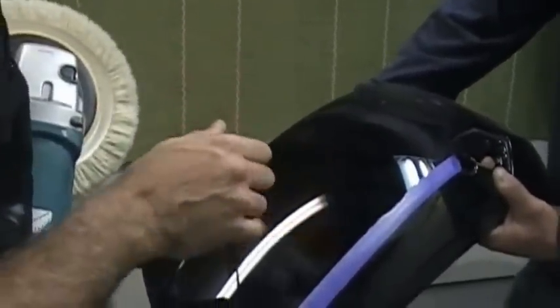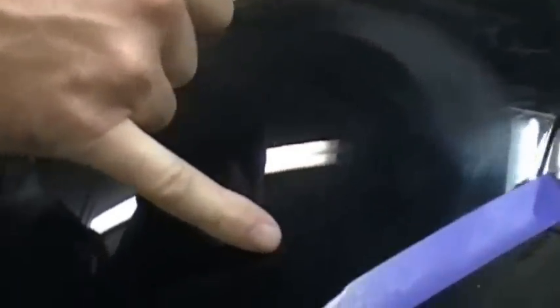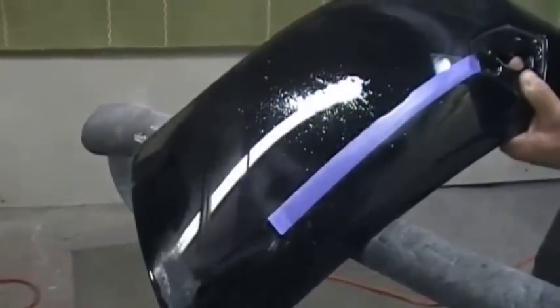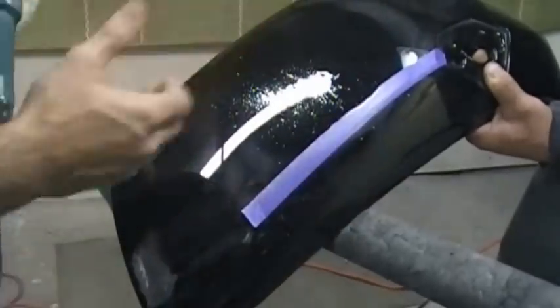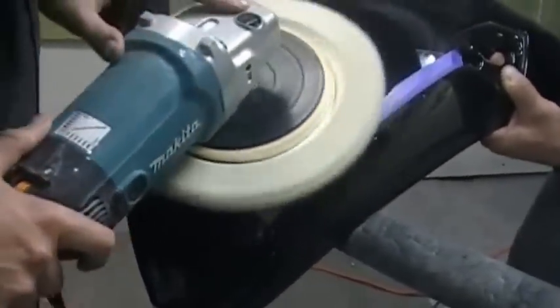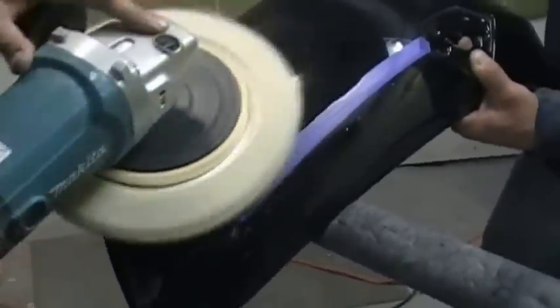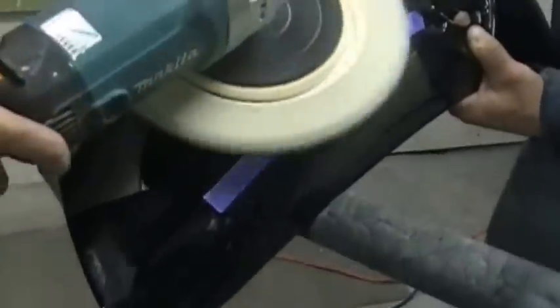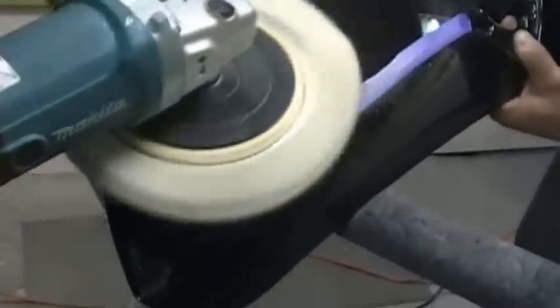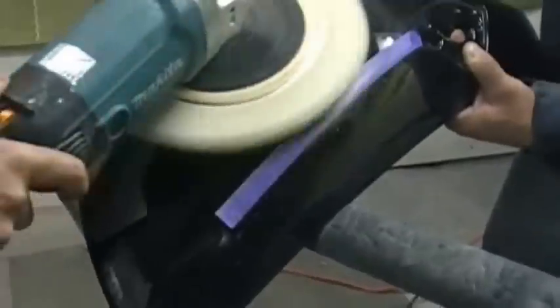You can see it is coming back to shine — it does not take a lot of effort because we used 1500. What I can see, and you probably cannot see it, but in the light right here there is still that tiny little scratch. Really, really tiny. One thing to keep in mind — fluorescent lights, like in your garage, will show all kinds of marks. So if you are really picky, do it under fluorescent light and it will show better. If you took this outside you would never see that. But if we are trying to get a show job, we just polish that a little bit more with the buffer and work that scratch right out.